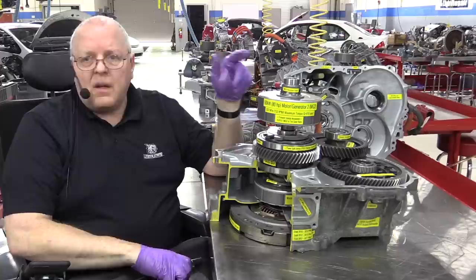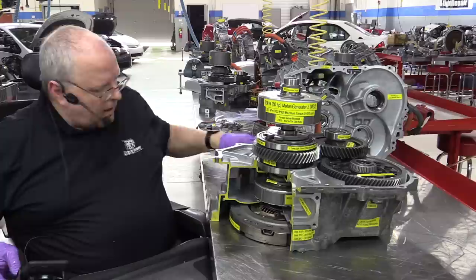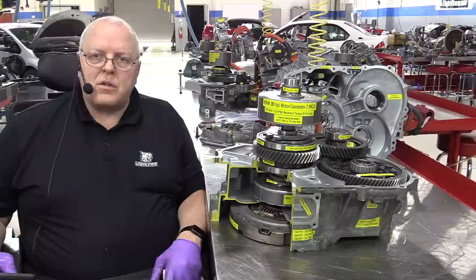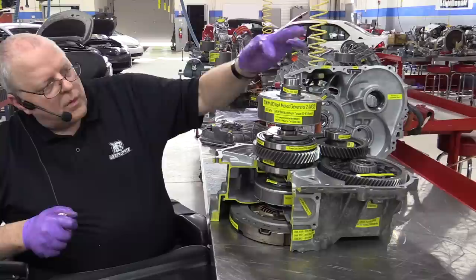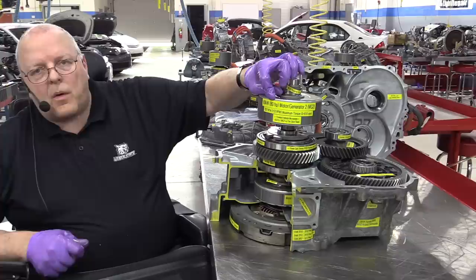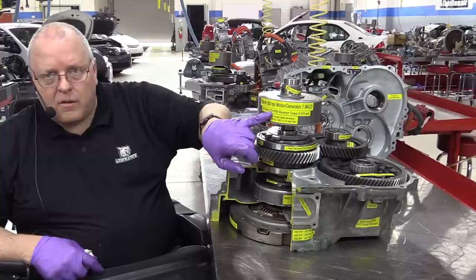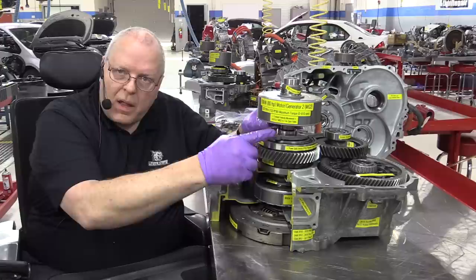Now, if we compare that to the second generation transaxle as far as the power ratings, we've got 80 horsepower and 153 pound-feet of torque. The second generation transaxle has 68 horsepower and 295 pound-feet of torque. So at first glance, you might think that the 68 horsepower, of course, is lower for the second generation, but the 295 pound-feet of torque on the second generation is much higher than the 153 we have here on the third. But you've got to remember, we now have another planetary gear set for gear reduction here on this third